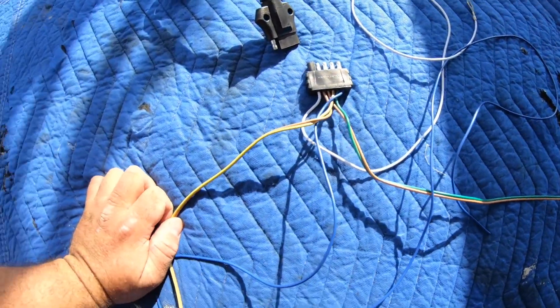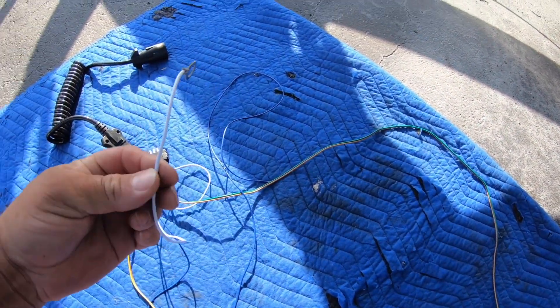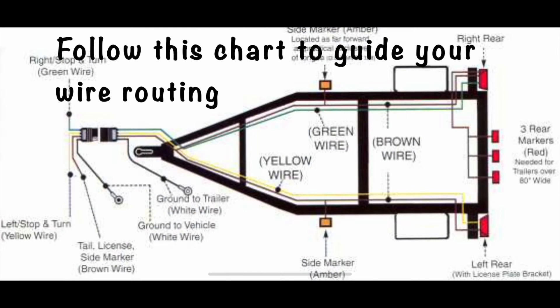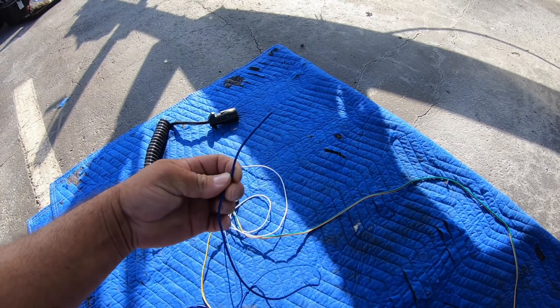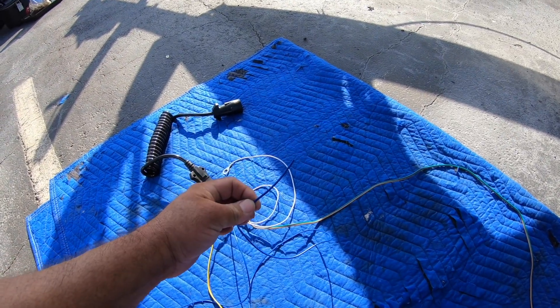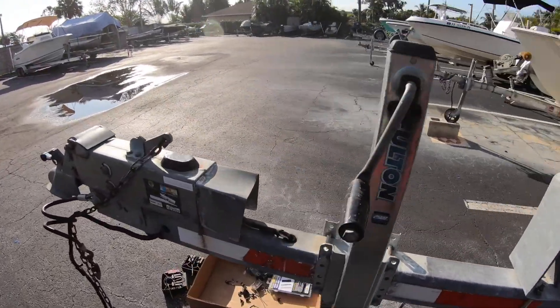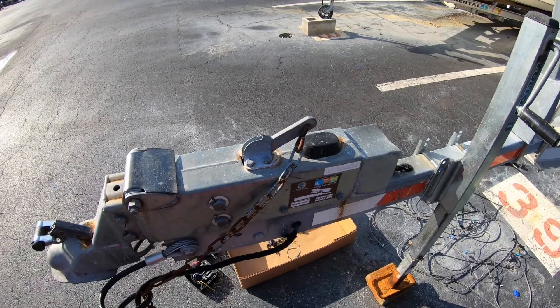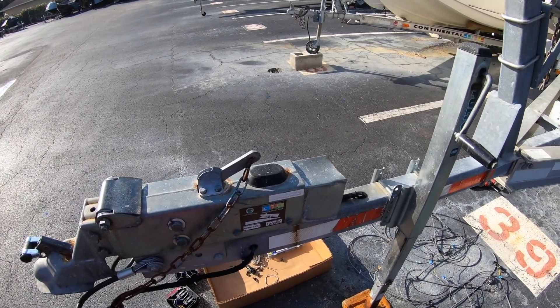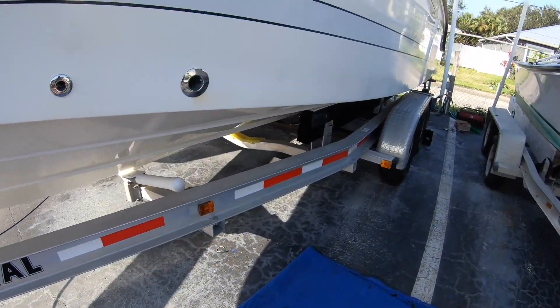The yellow and the brown will go down the port side of the trailer. We also have the blue wire and the white wire — the white wire is the trailer ground. Now, everybody forgets about the blue wire: the blue wire is for the trailer brake release. On this particular trailer we have the hydraulic piston built inside here. If you do not connect that blue wire and you go into reverse, it will not release the actuator to release the brakes, so when you go in reverse it's going to lock down on the brakes. Very important to make sure we install that.